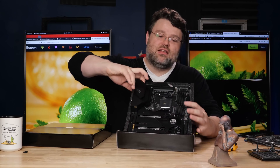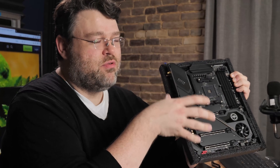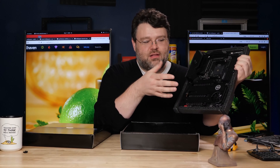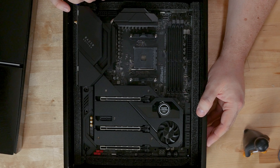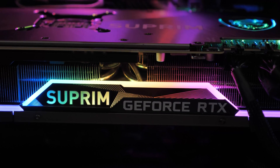The only real downside is that X570 brings a fan, but ASRock has incorporated lessons learned in board design. Look how far down the offset is for this fan — it's set up for a triple-slot GPU, and you've got so much room between the first and second slots that you could run two triple-slot GPUs in a standard case without too much headache. The USB-C connection is just high enough to clear a backplate even on cards with a thick rear backplate.